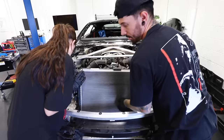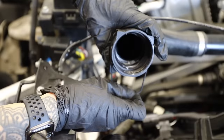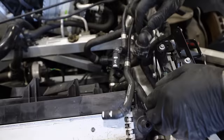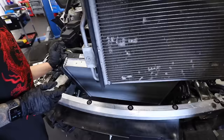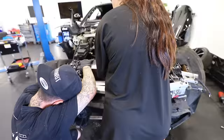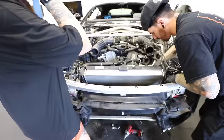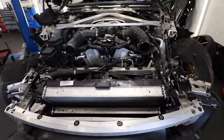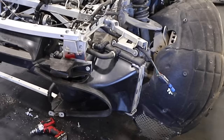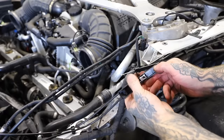There's one big main radiator for engine cooling, and because the engine is a C63 unit it has the same fittings as a C63 — no surprise there. In front of that goes the aircon condenser, and sandwiched between them is another radiator for the charge coolers and the two turbos. On top of that sits a secondary engine radiator, and in front of the passenger side wheel is a gearbox cooler. We're making progress.